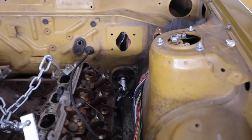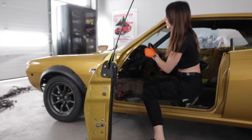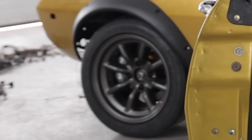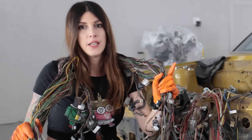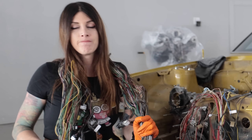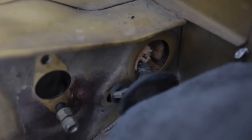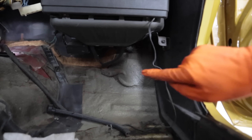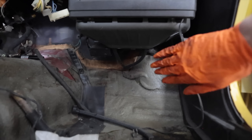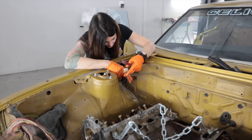Look at that — no more Bluetooth steering. I can actually turn the wheels in this thing. There's only one entry point in the firewall for this to fit through, but luckily the Celica is like half the size of a Tundra. I don't know how many wires I could fit through there — it's pretty small, but not much smaller than the one the original harness went through. I can either mount the ECU behind this kick panel or tuck it up under the dash, under the carpet maybe. I have the air conditioning unit right here so that's kind of in the way.